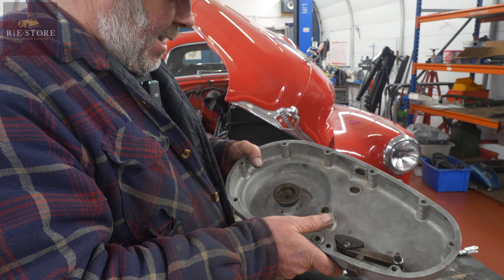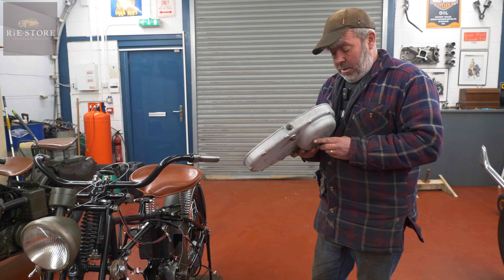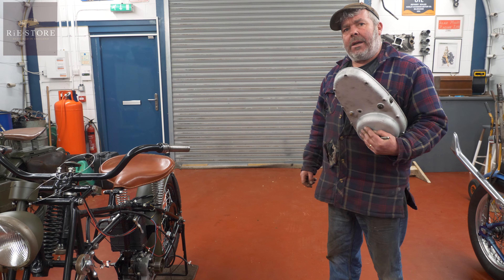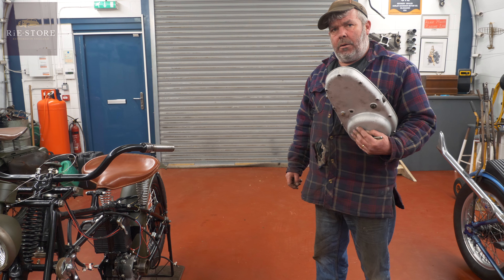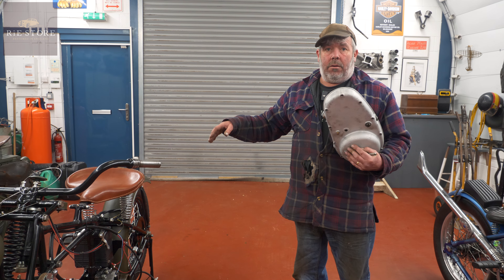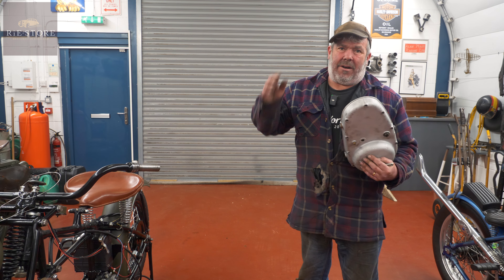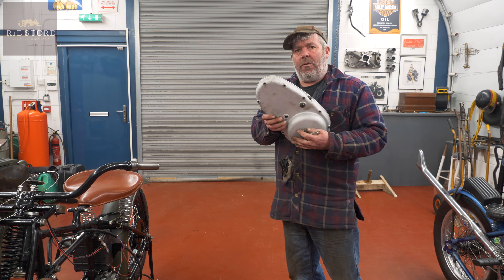That lets you adjust it — you take that plug out and feel the tension. The clutch has been rubbing here, which could be due to bad end play or similar. As for how long it takes to put one of these bikes together — probably the best part of a week. It doesn't sound a lot of work but it is. The engine was the bulk of the work. These are fiddly to put together; they're renowned for the chains not lining up and all sorts of weird things. With a Harley it's a one-piece frame and you pretty much just throw it together, but these take a little more fettling.